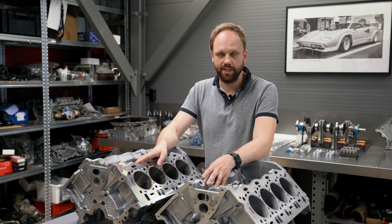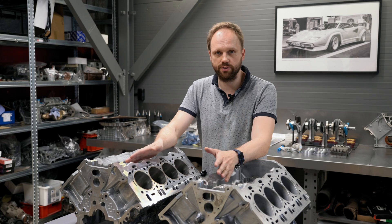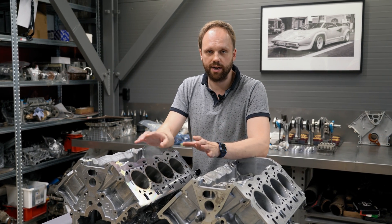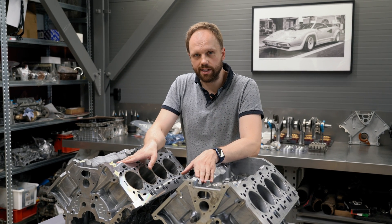The numbers are the same, the lettering is the same, and the sizing is almost the same. So the blocks are probably capable of the same horsepower on the N series, meaning the G30, G12, and all N63 TU2 engines and upwards come with the same casting as the F90.